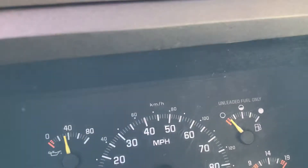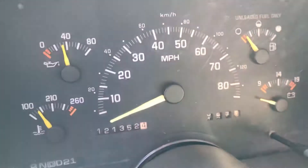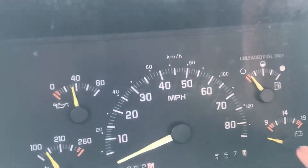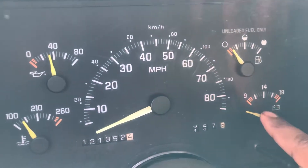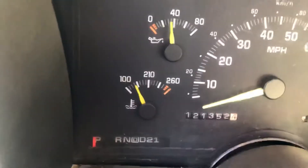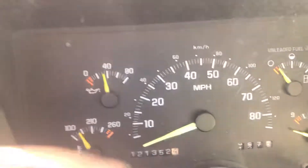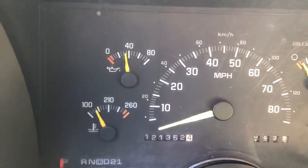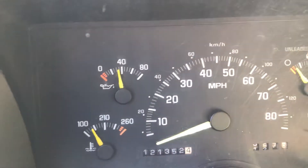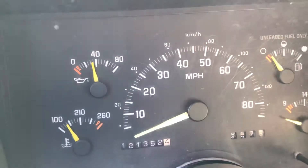This is the 94 GMC Sierra. The issue I was having was low voltage. Whenever I started the car up it would hover between the low mark and 14, and whenever I put a load on it it would drop into the orange — the gauges would be dancing and the engine was sputtering and cutting off. I found out it was my grounds, so I corrected the issue and everything is fixed now.